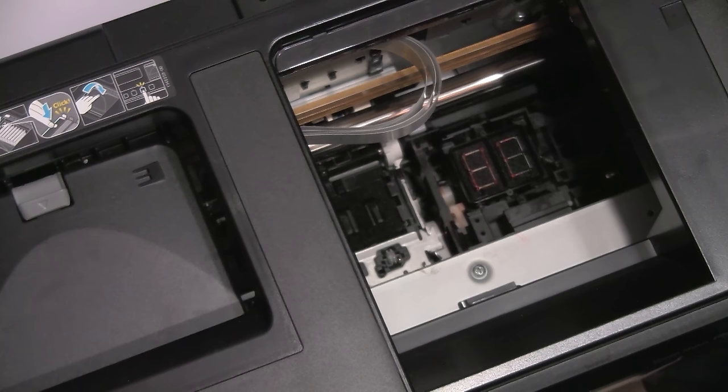There's no way to really isolate only the magenta ink from flowing — you would need RIP software to do that. There may be a combination of other colors creating a composite magenta, but most of the printing will be done by the magenta nozzles, and that has a tendency to clear the clog. If it does not, I will run a cleaning cycle, and that usually takes care of it. I have an external ink bottle to catch all waste ink generated, and a utility to reset my ink counter back to zero.